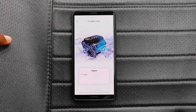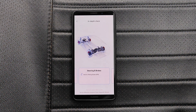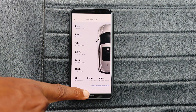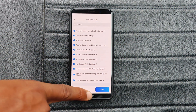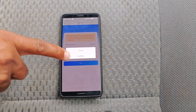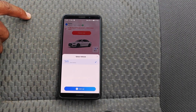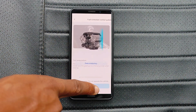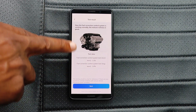In terms of cons for the AD20 and the AD20 Pro — internet access is required to run the in-depth scans or manufacturer level scans, because the tool has to link up with Xtool servers while performing these tests. Internet access is a given these days, but it's worth flagging. Another con is that since both tools have access to manufacturer level scanning for the engine ECU, I would have expected manufacturer level live data. Also, these two devices only pair with one car at a time — if I want to switch from my Honda to a Toyota, the pairing with this car is lost, and you'll need to go through the pairing process again when you return.